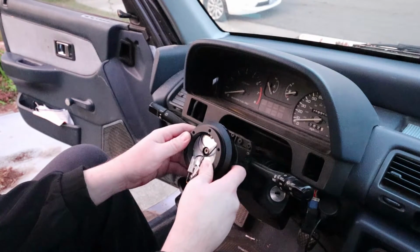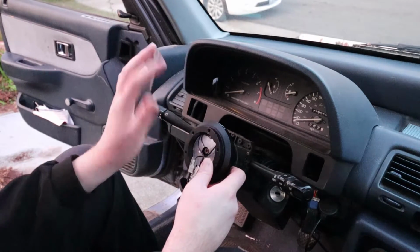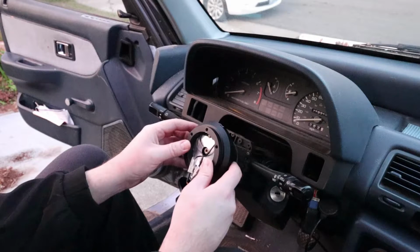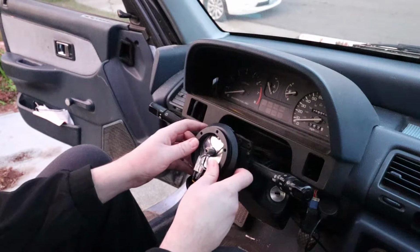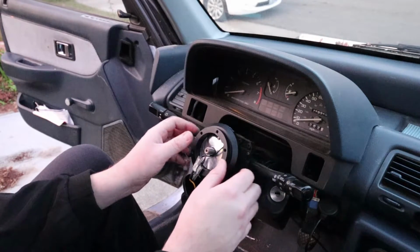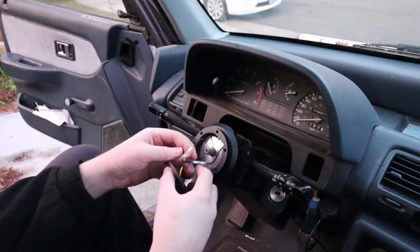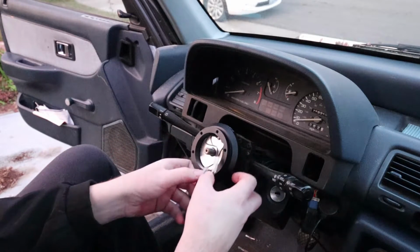And so if your steering wheel is off after you do this, and you drive around the block, say it's off to the left or the right, you're just going to pop this off until you get it on the right teeth on the spindle here. So you're just going to spin that around and wait till you find a nice straight point for your wheel.